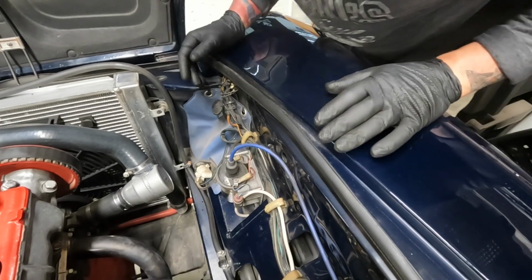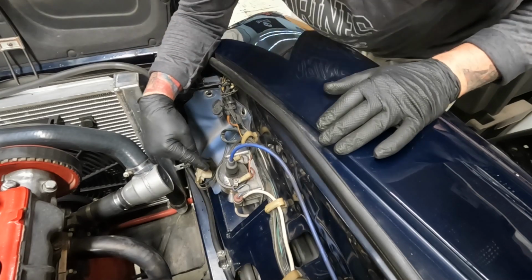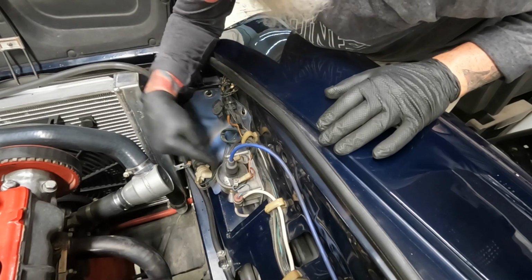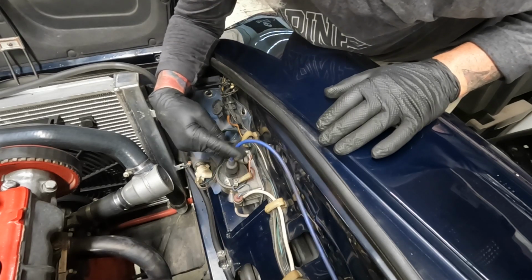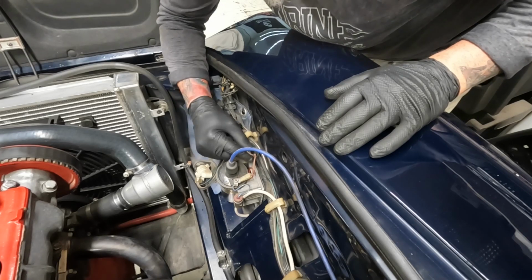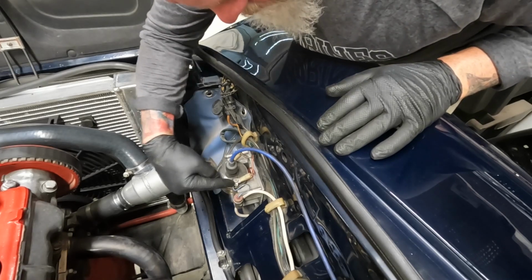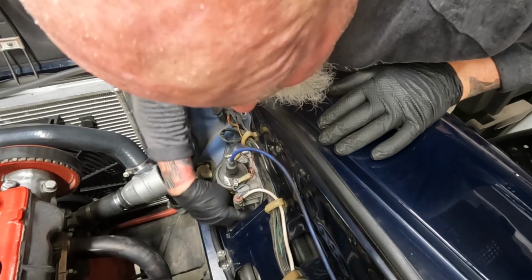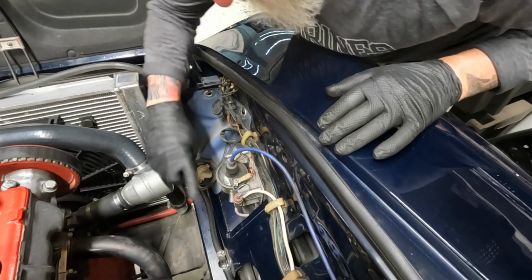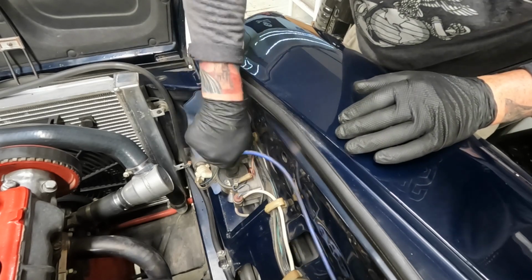So, on the coil side, there's a plus and a minus. Your application may be different, but for this purpose, we've got the pink wire going to plus, and I'm going to call this a brown wire with a white stripe going to minus, and then our condenser goes to plus, and then it's got the control module behind it, so red goes to hot, black goes to minus. The white wire is our magnetic pickup for inside, and the blue wire goes to our coil.